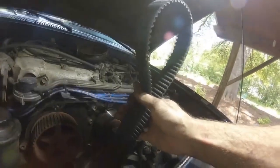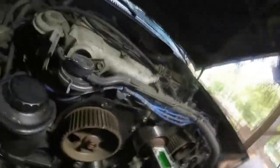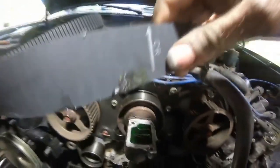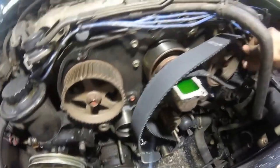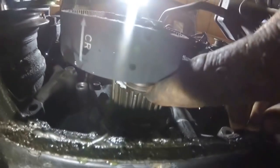We're ready to put on the new timing belt. You'll notice some marks on the timing belt — on this Toyota we have a mark for the right cam, a mark for the left cam, and on the bottom of the belt a mark for the crank. Lay the timing belt so you don't have a lot of slack down at the bottom because that'll make it more difficult when putting it on the crankshaft. The arrow on the belt for the crank needs to line up with the dot on the crank pulley.